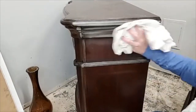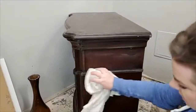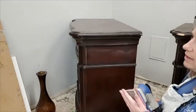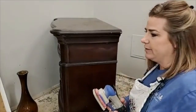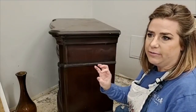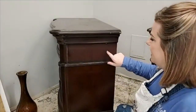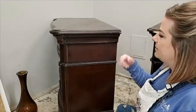On curved surfaces like this I can get in with my pad and ride my curves pretty easily. Scuff sanding is super easy — it would take ten to fifteen minutes versus an hour for Slick Stick. When you're scuffing, you want to use anywhere from 120 to 220 grit. I evaluate the finish. This one has a really thick clear coat, so I'm using a medium pad. You don't want a finish that's too low-grit if it's a thinner surface.